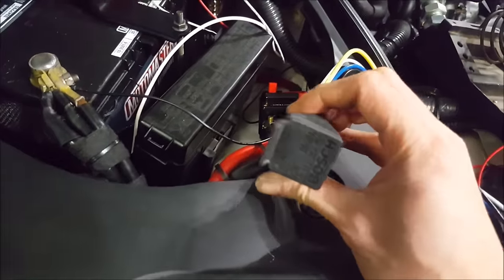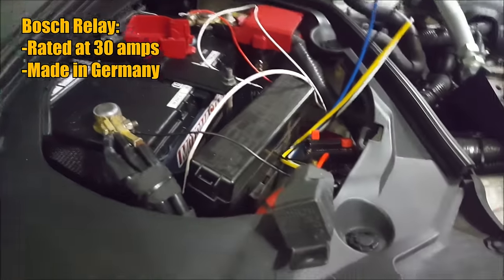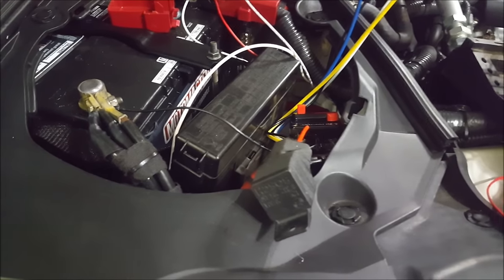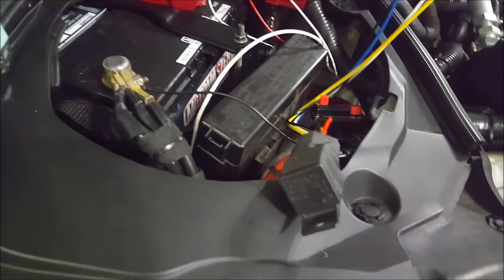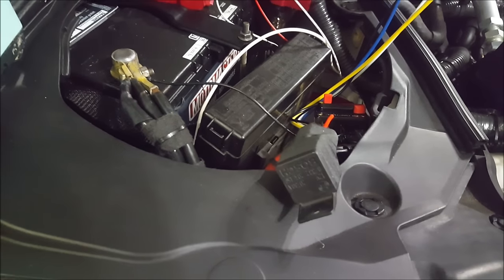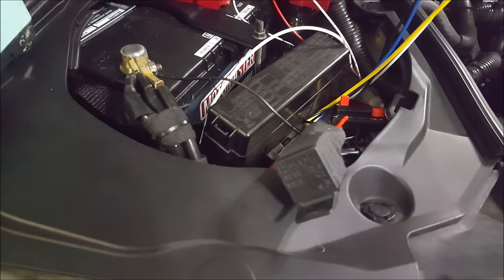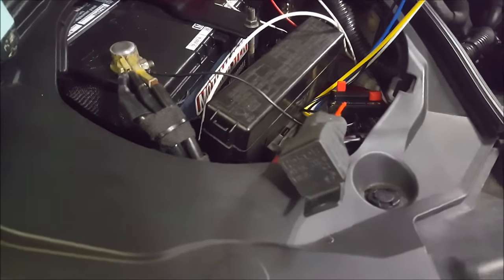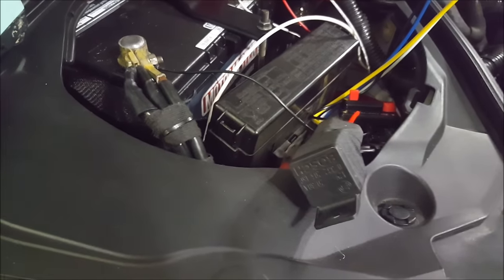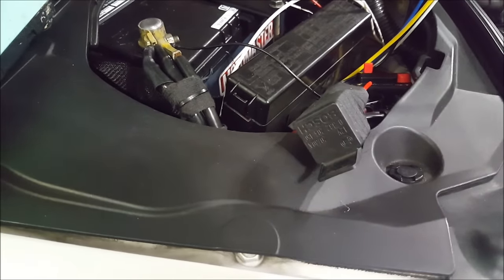Before I tuck this away — if you guys are wondering what relay I'm working with, I'm using a Bosch relay rated at 30 amps, which is more than enough to power our unit. I really love Bosch relays. Unfortunately it looks like they sold off the rights to Tyco and it's now made in Portugal. People that have been in the install game for a while will have a bunch of these still left over, and if you find them they're like gold — I've never seen one fail. If you ever get your hands on a Bosch relay, even if it's old from an old install, keep it, don't lose it.